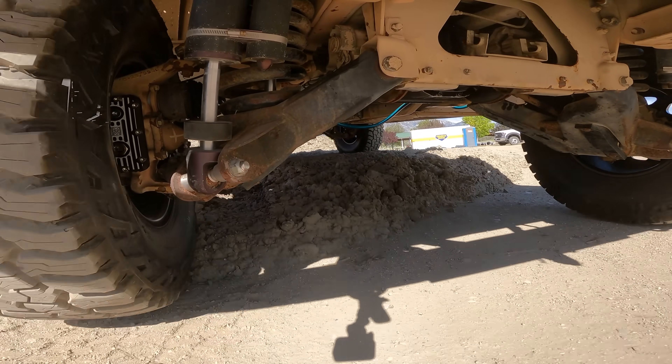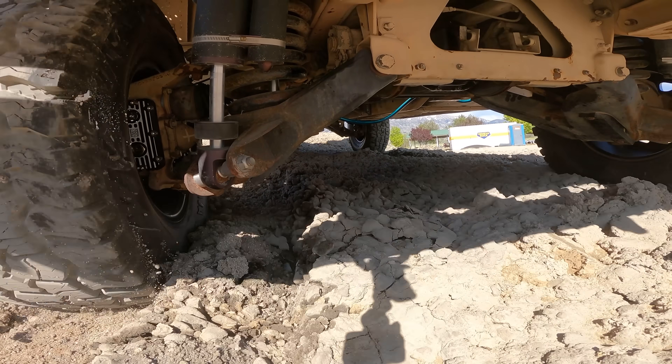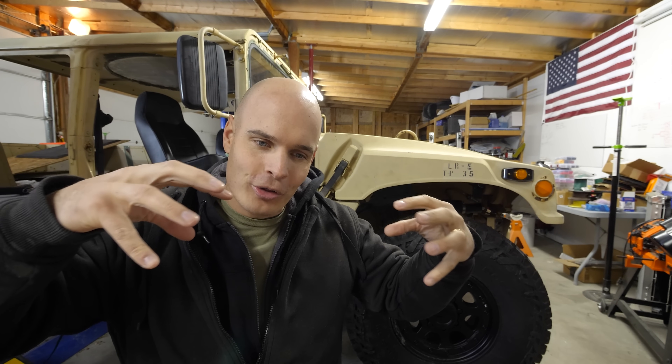For example, the charger is not connected, the coolant lines are kind of just dangling there, and for anyone who knows anything about electric vehicles, you know the charger is rather important to moving forward. I'm also having some issues with the CAN network — the two wires that get all the components talking with each other, like the charger, the screen, the inverter, and the VCU. I've been dabbling with it for the last 6 months trying to get it working, but let's get started.